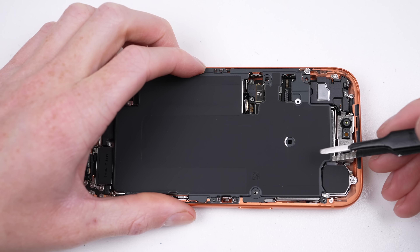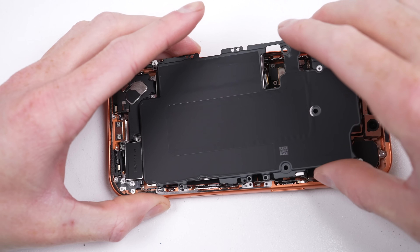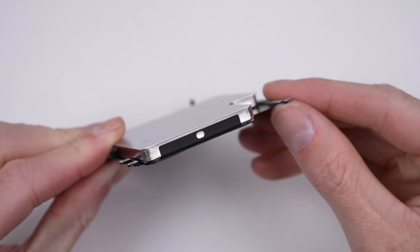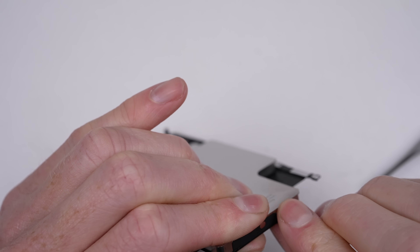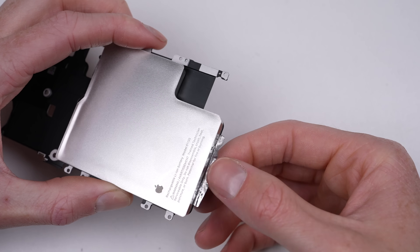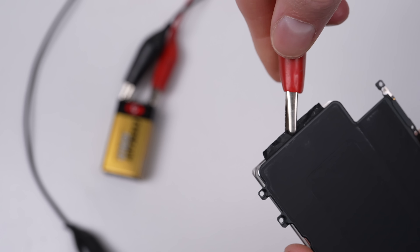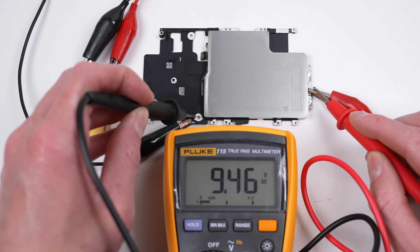Lifting up the vapor chamber — there's no battery, because it's stuck to the vapor chamber, which means it's technically screwed in. As we want to see the vapor chamber, I'll remove the battery from this metal bracket. While it might look like a pull tab, it isn't. Removal is similar to last year's iPhone models: a power supply of around 9 to 12 volts needs to be attached and left for a few minutes for the adhesive to break its bond. I had to take a bit of an educated guess as to where I needed to attach the wires — Apple usually mentions this in their repair manuals, however they've yet to be released for the 17 series phones.